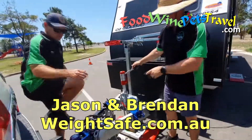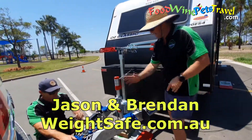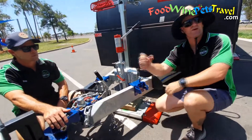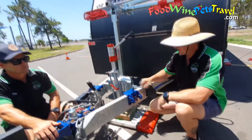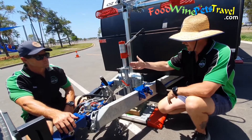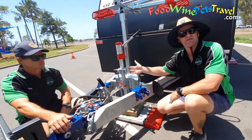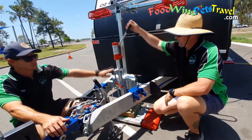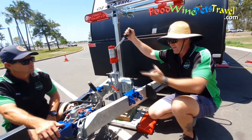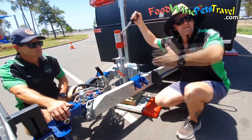So what we're doing, just as an experiment — the tow ball weight was 370 kilos. Now a lot of people at home, if they haven't got the equipment we've got, and they measure their tow ball weight with the spring-loaded tow ball thing from SuperCheap or any auto store, they quite often measure it under their jockey wheel, or kitchen scales under the jockey wheel. What we're trying to show is that there is a difference between measuring it there and actually measuring it where the weight is imposed on the vehicle.